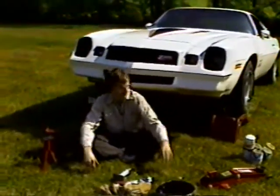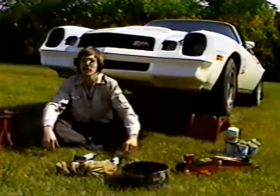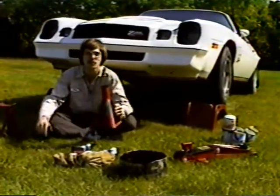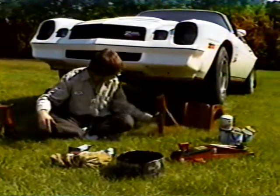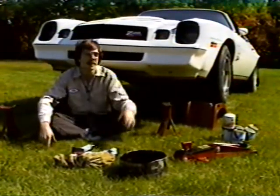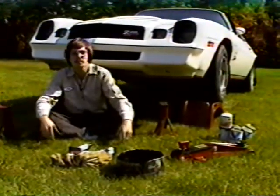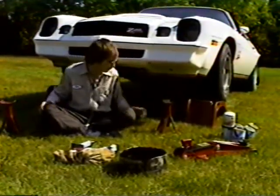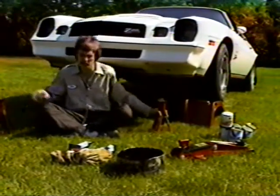Considering I'm out here on the grass today, the ramps won't come all the way up without leaving a patch in the grass. So I'm going to use the axle stands I just told you about, putting them underneath my axles. That way, if the car does come down and the ramps give way — though I've never seen a ramp give way — the stands will catch it. I wouldn't want to look like a pancake when I'm done.